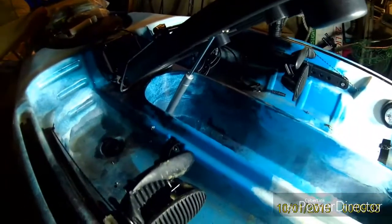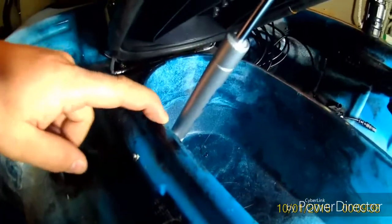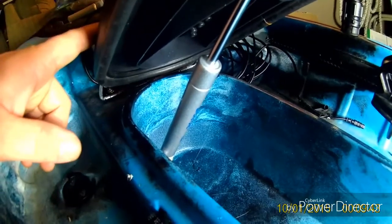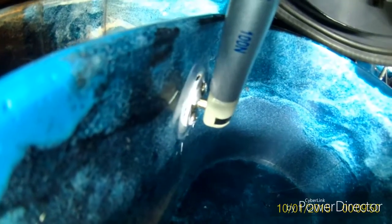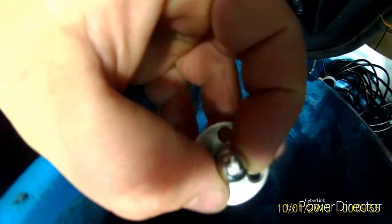Okay, so getting into how it's installed here, you will measure from the lip down 2 inches on the 20-inch mark of your hatch, and it's going to connect just like that. And you want the center of this piece here on the 2-inch mark, so you measure 2 inches down and you line it up with the ball when you connect it. So your 2-inch mark would be right there with this. Connect it there.